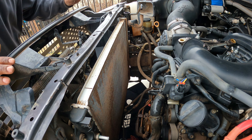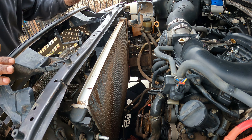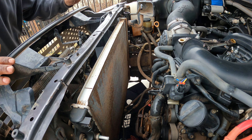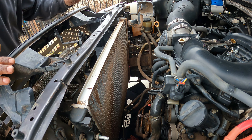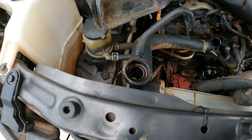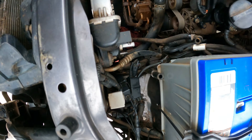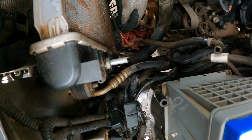This is a pretty cool view if you haven't seen a radiator like this before, which I haven't. So much room for activities down here. Next, we're going to start taking off the radiator itself. If you look on the back side, you can see it has a bolt right there connecting it to the frame — there's one on the other side, one way down there, and another one way down here. I believe they are 12 millimeters.